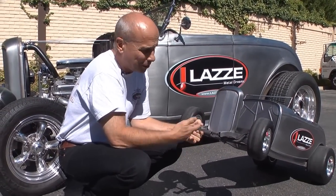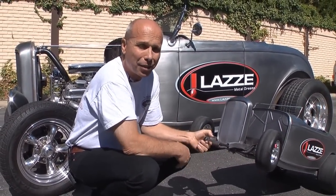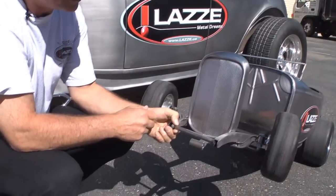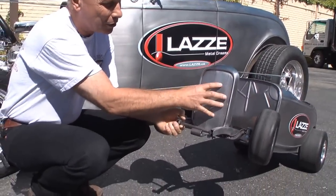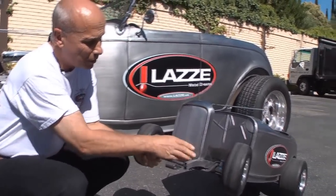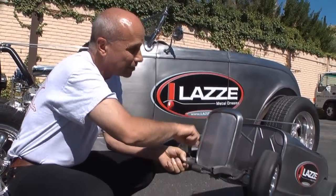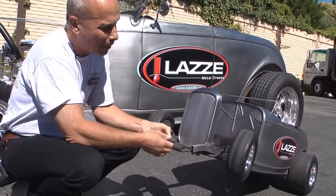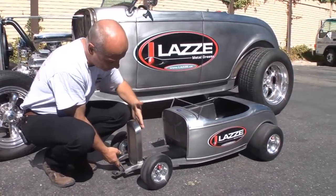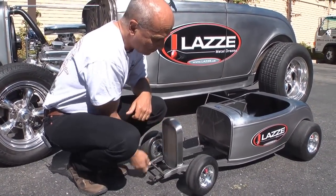It's pretty fun to do something and just use your imagination — in your imagination there are no limitations, you can think and do whatever you want. Then I had a little challenge making the grill. It took me a while to figure out how to make the grill insert and also the outer shell. It's one piece here and one piece to butt there, with an extra strip up top and the top piece and side on this one. Then hammer and TIG weld it, hammer and dolly it and get it to work. When everything was done, I ground this side in the back to the hood so it was flat to the table, then made a little step in the bead roller.